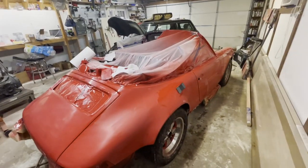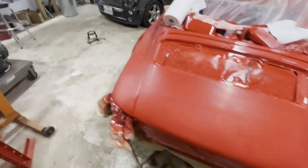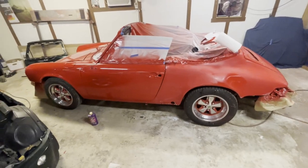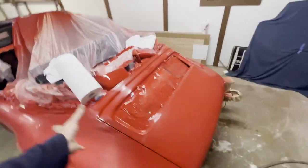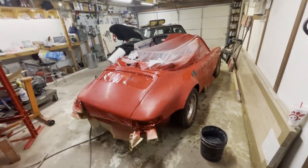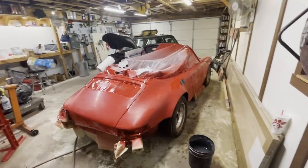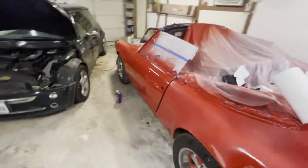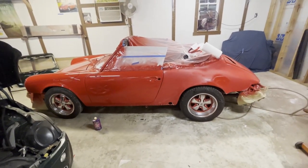If you take too much off, then you could go into the underlying base coat, and this will not only leave an imperfection in the coat, but it will also reduce that area's UV protection. So how much can you actually sand? This is going to be hard to say, but for me, I typically will put down not only the two recommended coats of clear, but I will put a third coat down. This, according to the tech sheet, should give me around 3 mils of clear. From my experience, I seem to put on a little more than that.